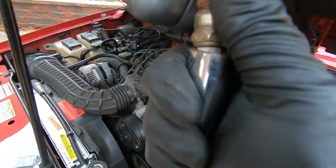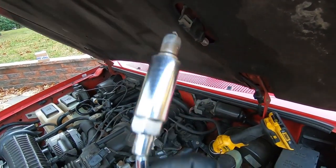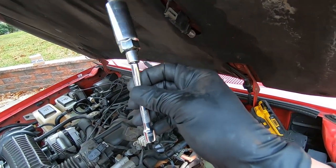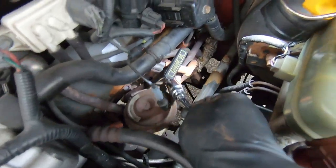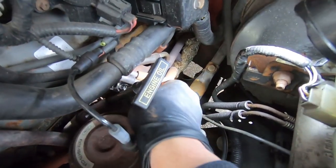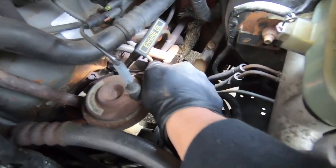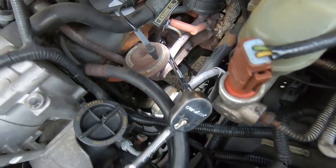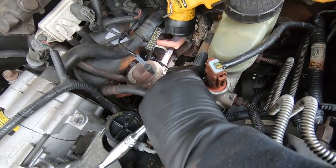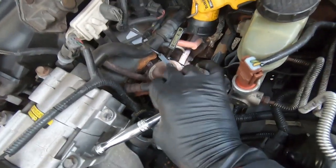By now we should know the routine — check the gap, this one was at about 54 to 55, littlest dab of anti-seize. To guide it in I have a four inch wobble extension, so that's how I'm going to access this. Going to guide this thing in here — this would have been a little easier to guide with than the big one, and that's why I did it. It worked because I'm catching threads. Going to finger tighten that in and then tighten it down with the socket wrench using the 10 inch extension — give it the littlest turn and I think we're locked in pretty good.